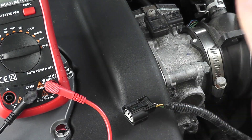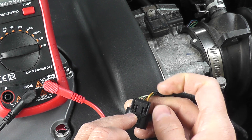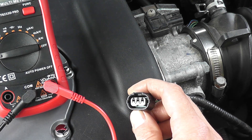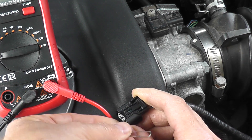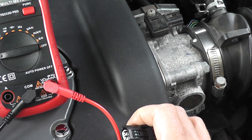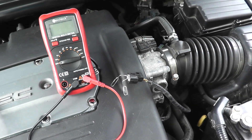A scan tool and a multimeter are, in my opinion, the two most important tools you must have for a modern vehicle. Take a look at the harness connector — you have three prongs here. We want to take a voltage reading, but they're very small and tight. The multimeter comes with a red and black lead, but it's hard to get a good reading. So what I tend to do is use a paper clip. Look for the red wire — this one is red and yellow, and that is the power wire. Just insert the paper clip into the harness connector.